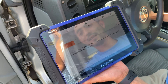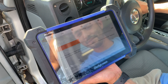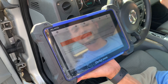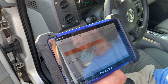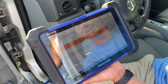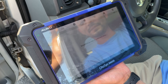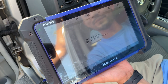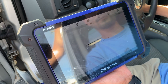It says press the lock and unlock button at the same time - that's different. On other tools it would just program the chip, but sometimes the remote doesn't work after you program the key, so that's why it's asking you to do that - to program the remote as well. Key learning successful - key is programmed, number one. You can start the engine; always turn it off and then back on.